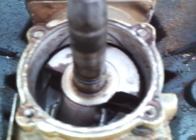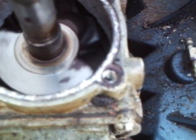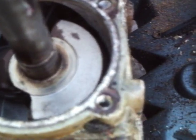We may be taking the points out after all. I'm sorry everybody, we're not going to get it to run today. Here's the Tecumseh — the official Tecumseh engine. Everything looks okay. We're restoring this thing. Here's the basic problem — just a bad condenser. Crappy condenser, y'all.